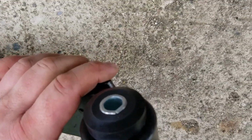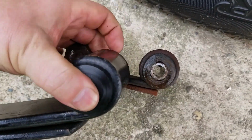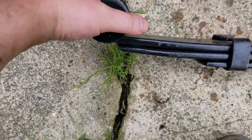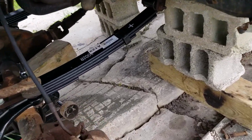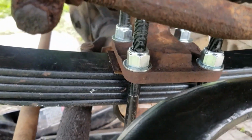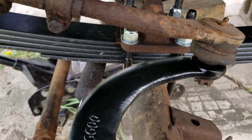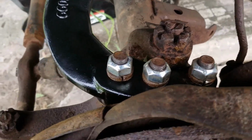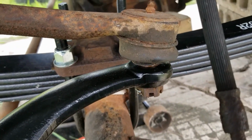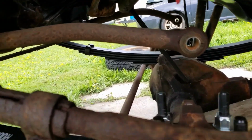Sleeve slide right in. Pretty flush on each side. It's good. Big bushing, big hole. Got new spring in. Torque. Those are torqued. Got steering arm in. All three torqued. Lots of anti-seize. Don't want sticking. Drag link in. Tight. Sway bar not in. Mongo confused.